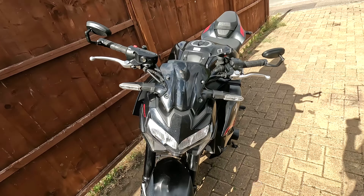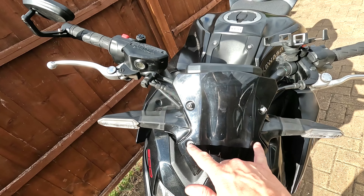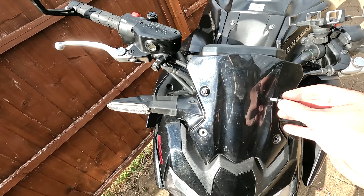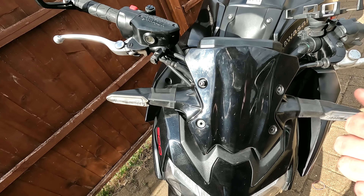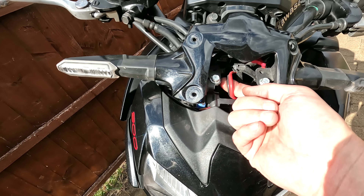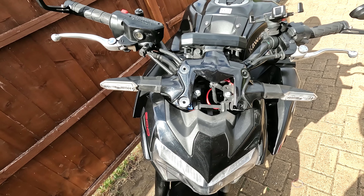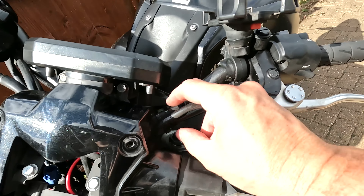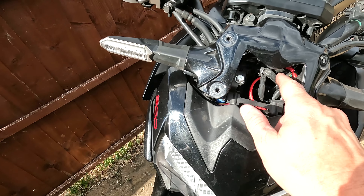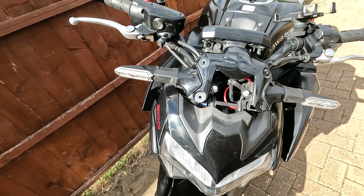And here's how to fit it. In traditional Blue Peter style, here's what I prepared earlier. There are four allen bolts that hold on this front shield, so they come off — just be careful when you take them off because they've got little black rubber washers underneath them. With that front screen off you can see some of the gubbins inside and you can see this cable here which is the one I've added. It's deliberately left longer because I'm not trying to integrate it into the fabric of the motorbike — it's an add-on. The USB tender itself is zip-tied onto another cable, it's not permanent, and I don't want the wires taped up with the rest of the wiring loom. It's been deliberately left long and colourful so that it stands out and you can see it's just an add-on.